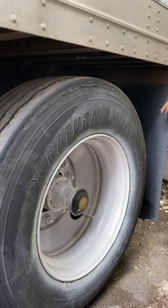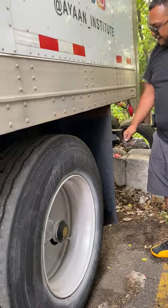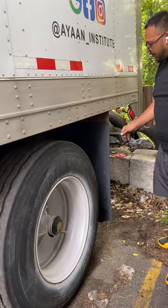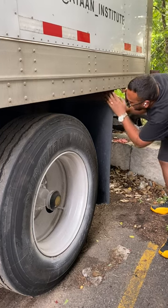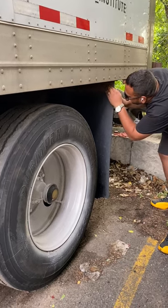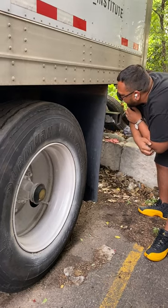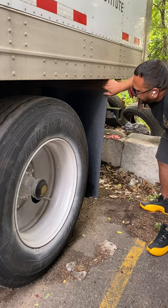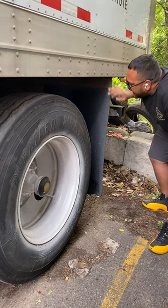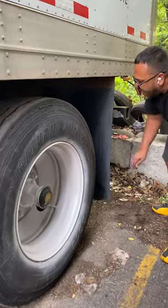To wrap up with my axle: my mud flap — no abrasion, no bulges, no cuts, properly mounted and secure to my axle. All mounting bolts not rusted, not cracked, none are missing, and I have proper clearance between the tire and the mud flap.